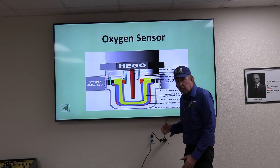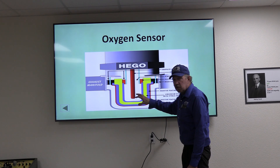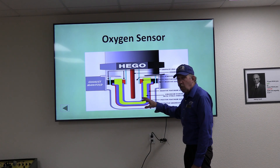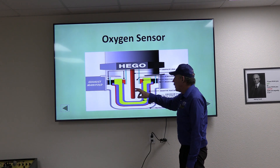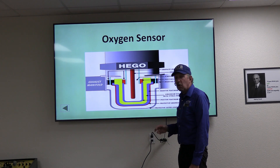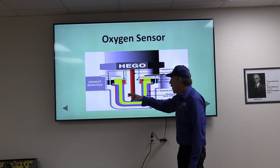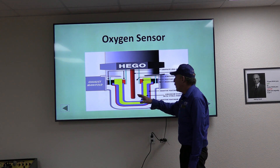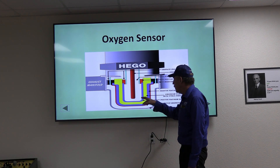The four-wire sensor we've been discussing was originally considered a wide-range air-fuel sensor because it reads from 11:1 rich to 17:1 lean — far beyond just stoichiometric. The heater draws close to two amps when cold but about one amp once running. Early sensors had the heater turned fully on, but this risked steam-flashing any water in the sensor and cracking the zirconium dioxide. Later vehicles duty-cycle the heater to slowly ramp up temperature and avoid steam-bursting the zirconium.